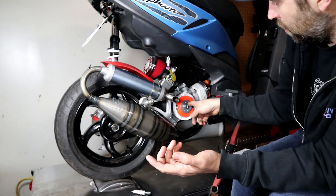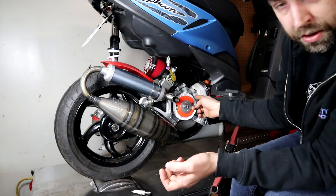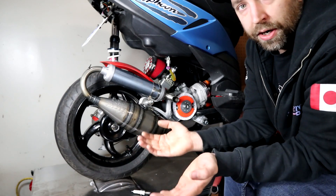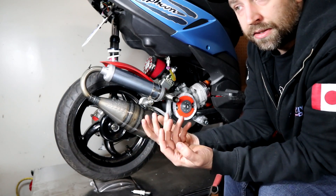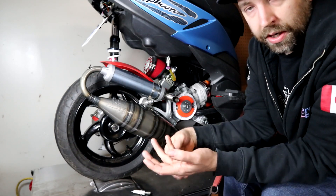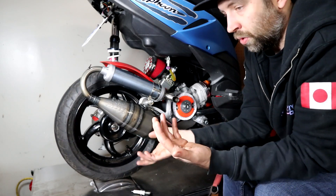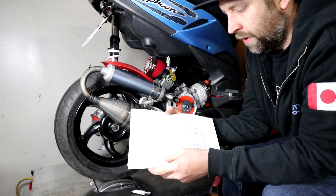It's not that hard to tell — if you have a degree wheel, you start the bike up, check where it is at idle, then rev it all the way out and check where it goes to. You get an idea of how much advance you have, so you can scale that around to where you want it. That's why the timing light becomes much more useful — you can actually move things in degree increments and see if that gives you better drivability, more power, cooler temperatures, whatever you're looking for.